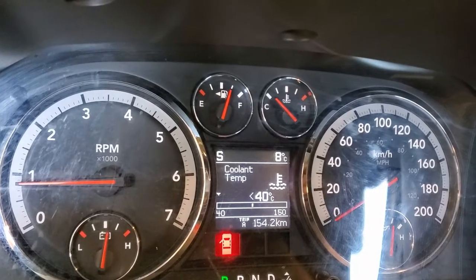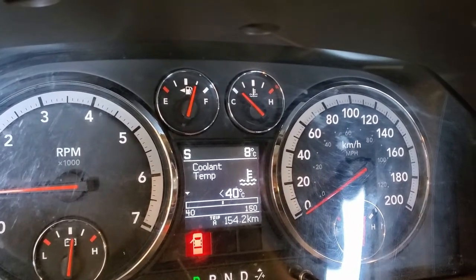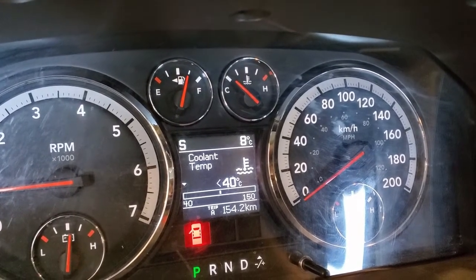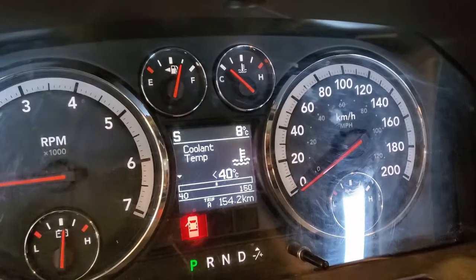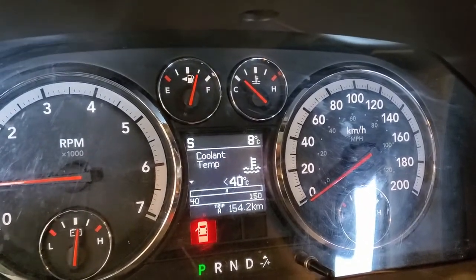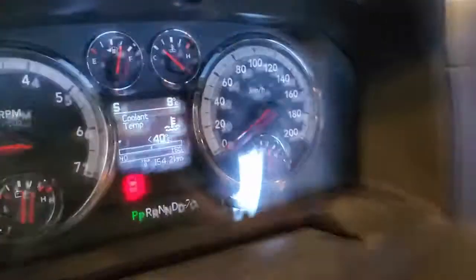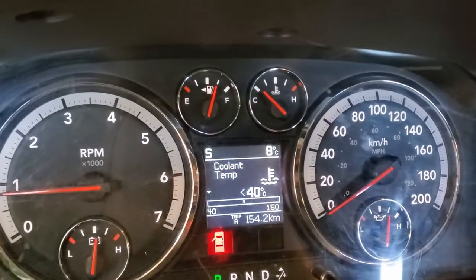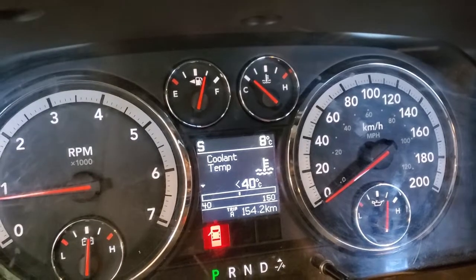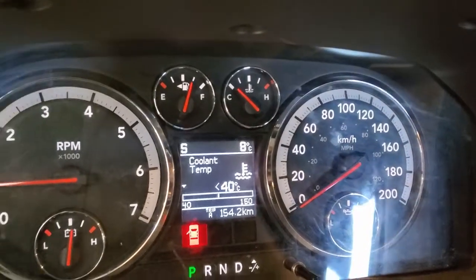Rev it up a little bit — up to about 2,000 RPM for about a minute. That just helps circulate it all around. So we're going to do that, try to get the level up as much as we can. We know how much we took out. There's a lot more on the block — I could have taken out the plug in the side, I actually did try, but it was really seized in there. I didn't want to round that out — that'll be a later problem. With the old coolant as diluted as it was, we got most of the stuff out, putting a lot of fresh stuff in. I'm pretty sure we got most of the flush out. We got all new mixed stuff in, so just letting it warm up a bit. Then I'm going to rev it up to 1,500 to 2,000 RPM. We really want that thermostat to open, because as soon as that opens, that's going to let the rest of the coolant circulate. Then just keep an eye on it, keep topping it up, and I'm going to go for a drive later.